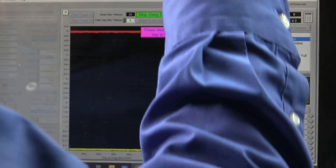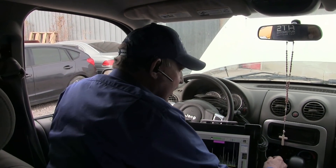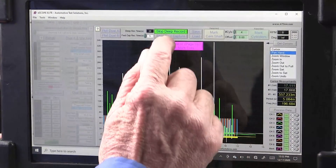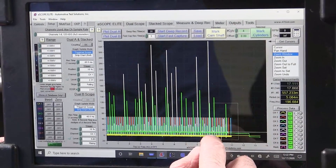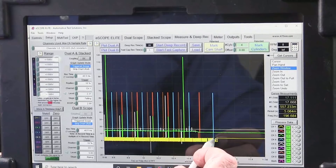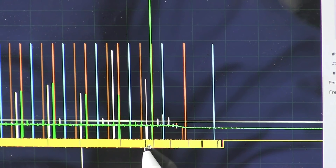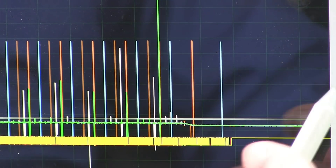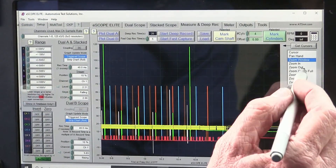What I want to do is do this again. Let's see if it will die again. Turn the fan on — it did, it died. Let's go ahead and get the zoom window and look at this. I can see right here where we started to die. Anything on this side, that's not what died. It's got to be up in front of here where we start to die, and this is slowing the crank down right here. Let's go ahead and separate these.